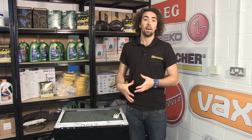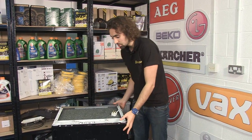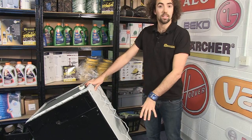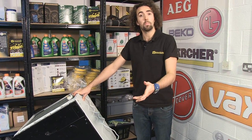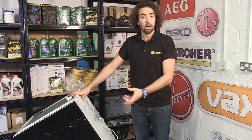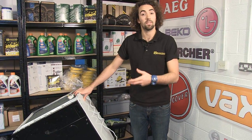The first point at which you might get a fault code is when you turn the dishwasher on. If water has leaked into it, the dishwasher may register this as a flood and you'll hear the drain pump whirring continuously as it tries to get rid of that water. You can check for leakage just by tilting the dishwasher onto its side and watching to see if any water drains out the bottom. If it does, take the base off the dishwasher and look inside at the pipes for any damage. It may also be that the detergent has simply foamed too much and caused a leakage. Whatever happens, get rid of any water or anything causing the leak, then put the base back on and turn the dishwasher on again to see if that resolves the problem.